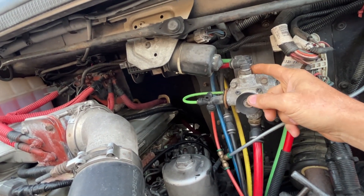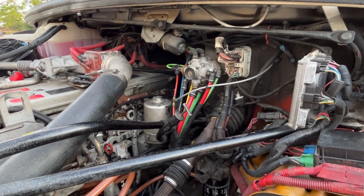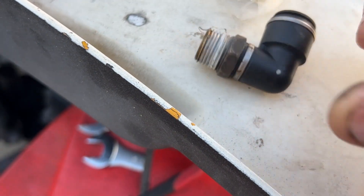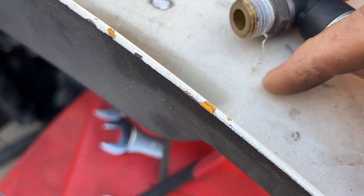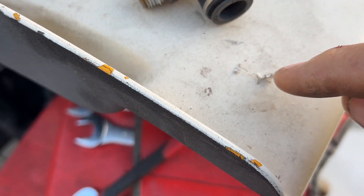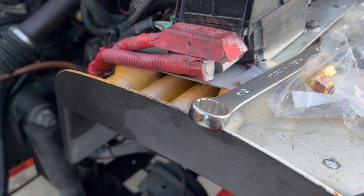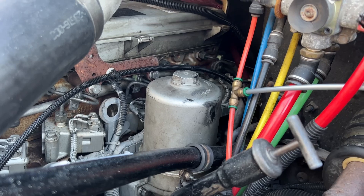I should only need a bunch of open-end wrenches and I'm pretty sure they're all standard inch size. These came out real easy — you just compress this piece back, and that lifts up the little fingers holding on to the hose so you can slide the hose right out. I don't like that they used Teflon tape — these little pieces can work their way into the airline area. I was taught never to use Teflon tape on anything other than sprinkler lines. See all these little pieces breaking off here?